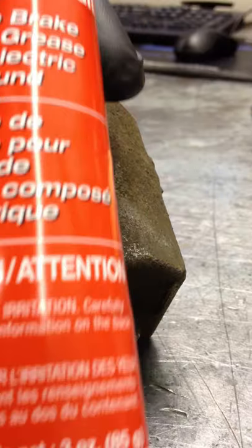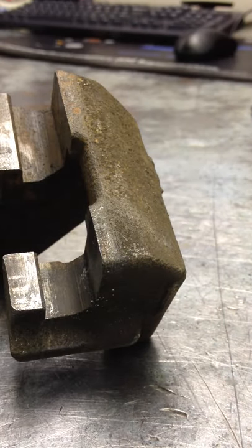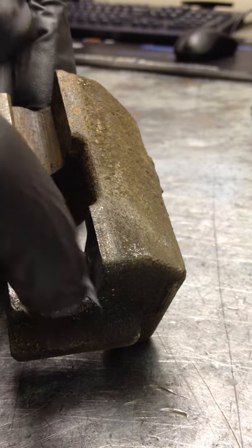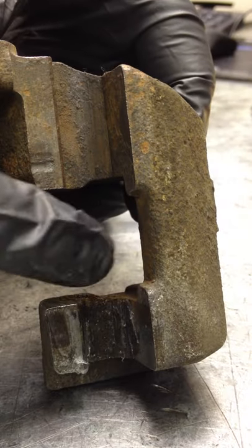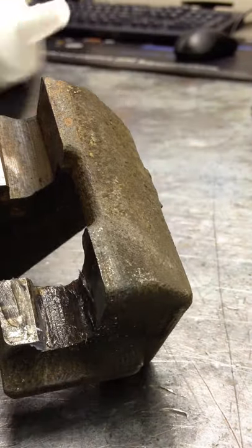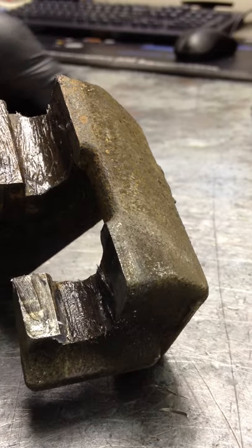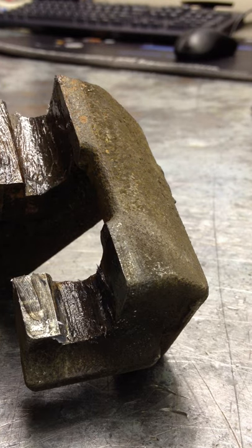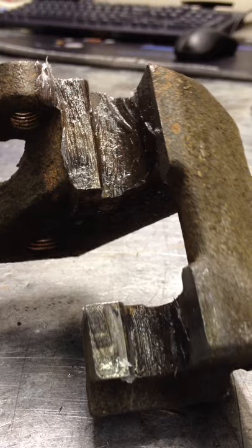You're going to want to put some dielectric compound — silicone brake caliper grease — on there. Get the silicone stuff; it's thick. Put it in all the areas where the pad rides. Make sure this inner edge here is clear, no big gunk sticking over it. Just enough on there — this will quiet the pad, provide free movement, anti-chatter, anti-click. It's resistant to heat. Just don't put too much on and don't get it in the center part.